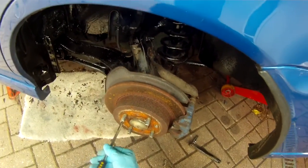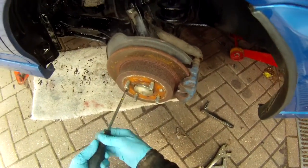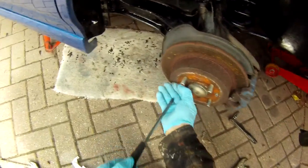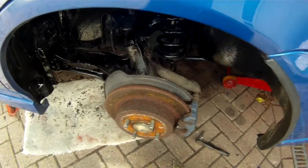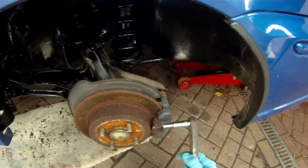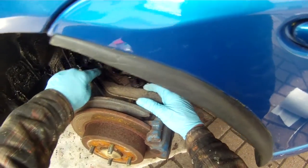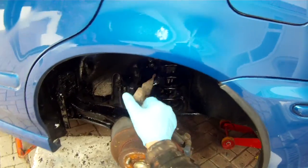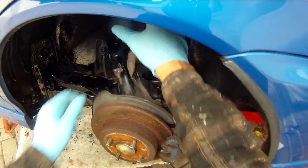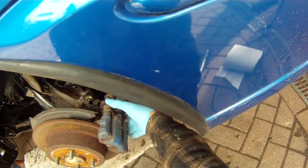The wheel securely holds the disc in place. The handbrake is currently on, so get rid of these screws while that's the case. Then remove the dust shield at the back — you need an eight millimeter spanner or socket and wrench. They're eight mil bolts normally. Don't need to remove the top one, just push that dust shield out of the way. Next job is to remove the bolts for the guide pins for the caliper.